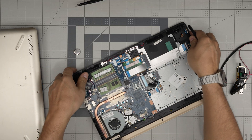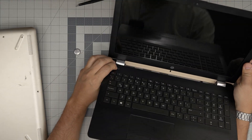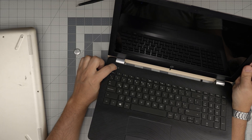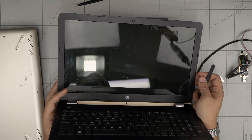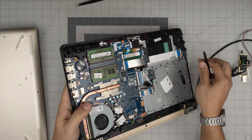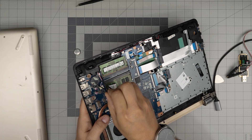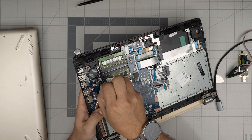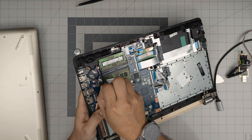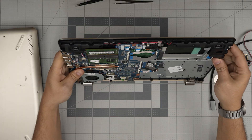Not all laptops have a dedicated BIOS battery. People say to remove the internal CMOS battery and press the power button for a few seconds while disconnecting the BIOS battery - this is supposed to reset the password. Let's try it - I'm holding it for about one minute. After that, people say to create a short between the positive and negative of the BIOS terminals and hold for a few seconds. This will reset BIOS configuration but will NOT erase the BIOS password.